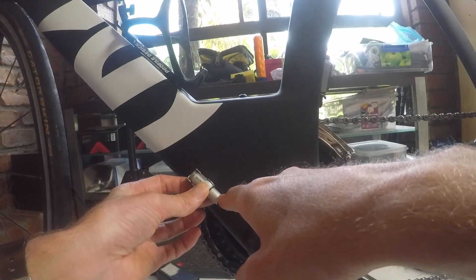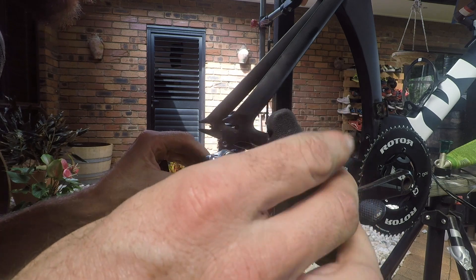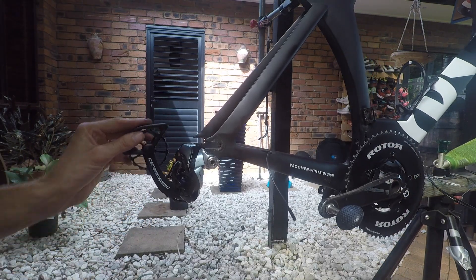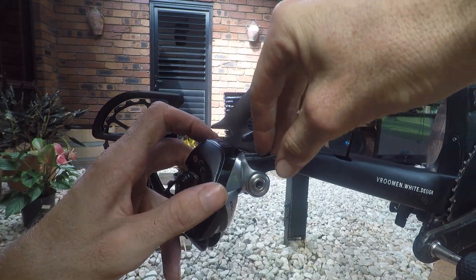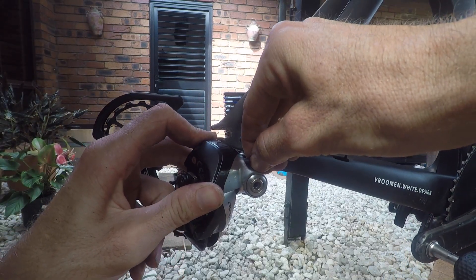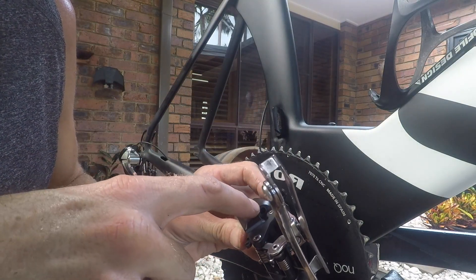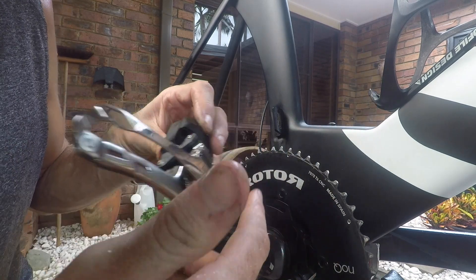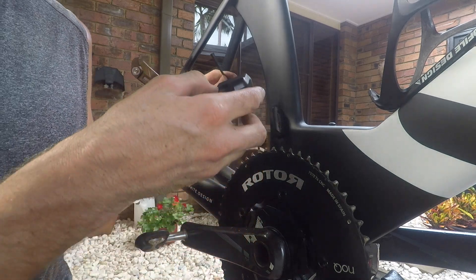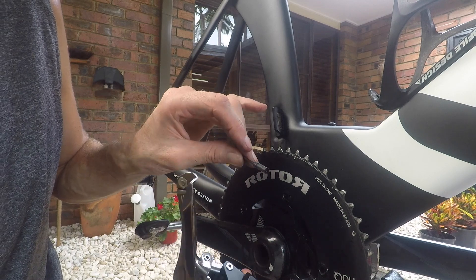You'll have a small cable included that will come out of the Bluetooth unit and connect into junction box B. We can now attach the front and rear derailleurs. For the front derailleur cable, the e-tube hooks in here, wraps around the side, clips into this back cable, and then goes in through that hole to keep it nice and neat. If they're a bit tricky to get in, you can use pointy-nosed pliers or there is a special tool.